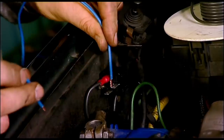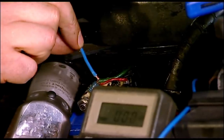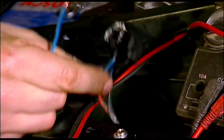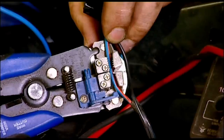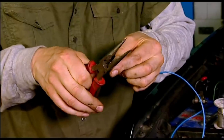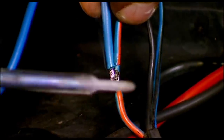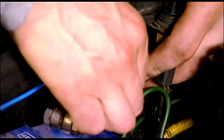With the earth in place and the relay in place, I can take a wire, connect it onto the other side of the low current part of the relay, and then connect it up to the positive battery. That little click means the relay is working when we have a positive feed to the other side of the relay. So now I need to connect that positive feed up to the signal wire from the high beam. I'm using a wire stripper to split the wire's insulation so I can get the power for my spotlights from the high beam feed. Then I'm soldering my new wire to it. A bit of insulation tape protects it. I can now connect the takeoff from the high beam wire to the low current side of the relay.